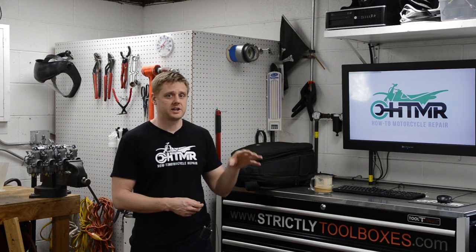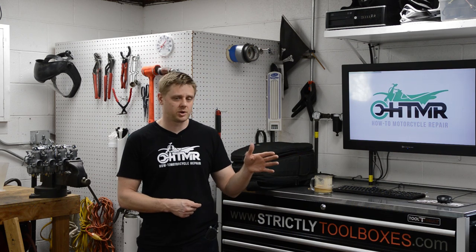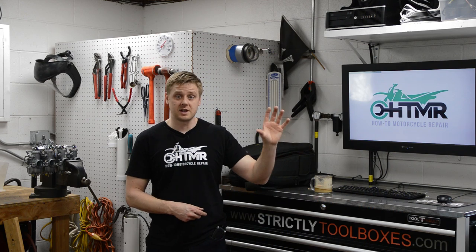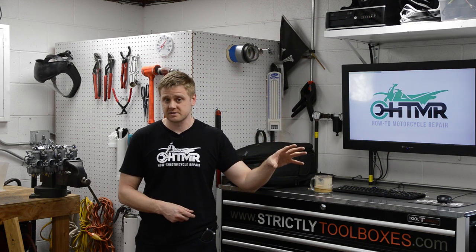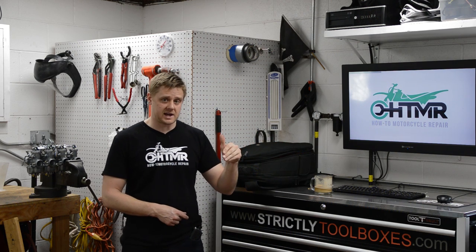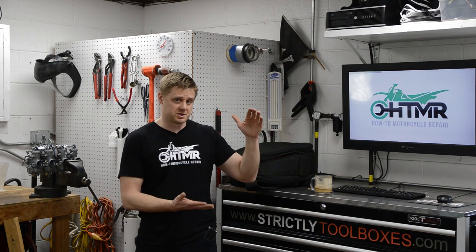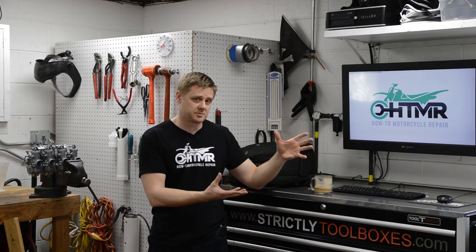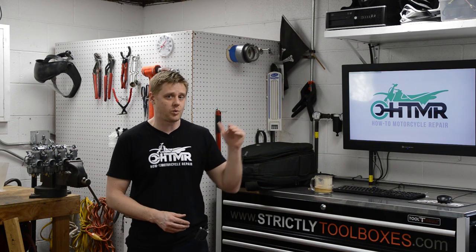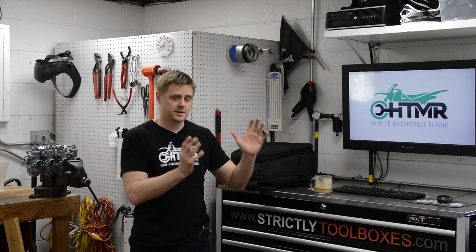So one last point. If you clean a lot of carburetors, look into dry soda. You can build a setup with the Harbor Freight cabinet, Dust Deputy, all that stuff. You can get it going for about $300, and that works really well. Now, for vapor blasting, I've got bare bones plans and a parts list. For $550, you could probably get into vapor blasting. It's not going to have a lot of bells and whistles and features, but at least it'll be wet blasting. So that's the entry to those methods.